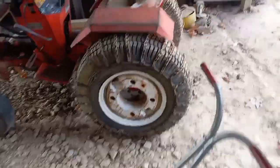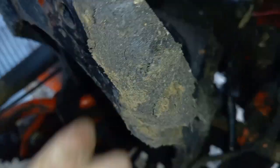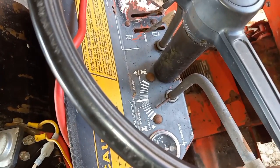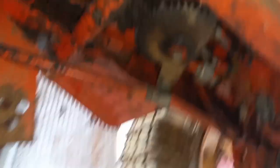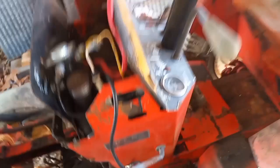The next issue I take up with these Cases is that instead of using hydrostatic drive, they use hydraulic drive — a hydraulic gear pump. On these it's a fixed gear pump. I understand why they did it: you can buy a gear pump really affordably off the shelf. They engineered a valve that modulates better than a typical directional control valve by putting little detent notches in, but I have never felt good about it. You really have to maintain all of the linkages to very precise tolerances to get a good feel out of this drive system.